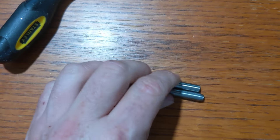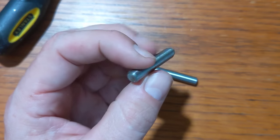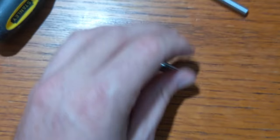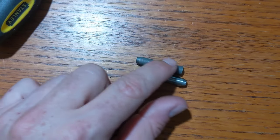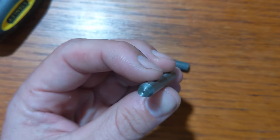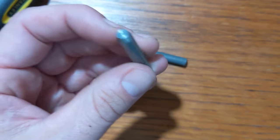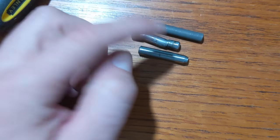Fortunately I ordered some real ones — these are the original supposedly Evinrude-branded shear pins from eBay. I don't know how old they are but they look nicer than the old one, which looks like it's made out of lead. These at least look like they're made out of a real metal. Hopefully these have the correct tolerance to hold that propeller on under normal engine operation but still break if I hit something, unlike the old one that just bent. We'll have to wait until the next video to see if this boat runs any better. Check out my other videos on the progress of rebuilding this free speedboat, and go ahead and like and subscribe if you haven't already — thanks for watching.